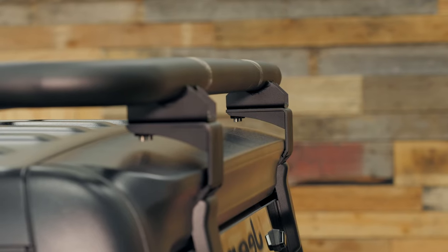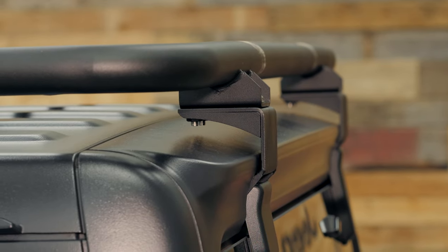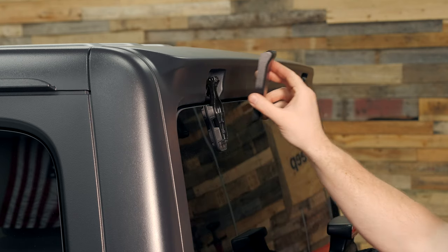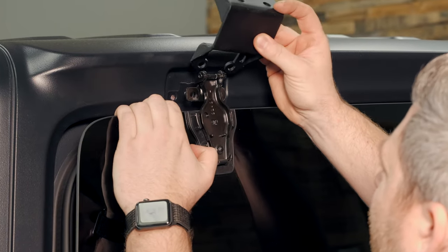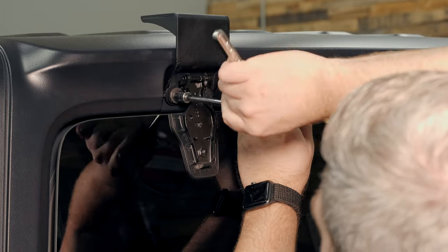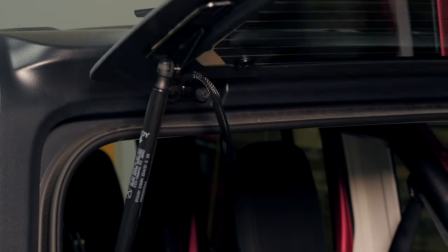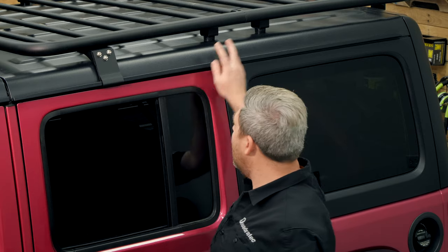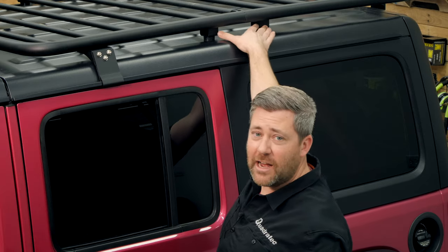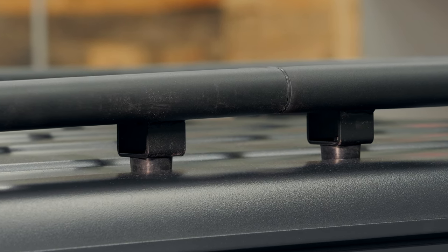At the back corners of the rack it's utilizing a lift glass hinge mount designed to install underneath the factory lift glass hinges. You simply remove the plastic cover and the two factory bolts holding that hinge to the hard top, slip the bracket in place behind the hinge, then reinstall those factory bolts and the plastic cover — again requiring no permanent modification or drilling through your hard top. There are also a pair of rubber bumpers, two per side at the center of the rack, to help better distribute the load.